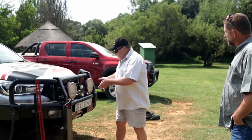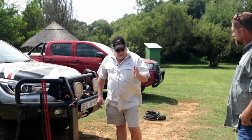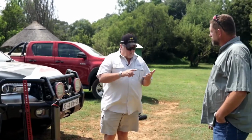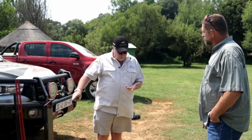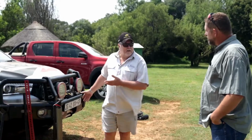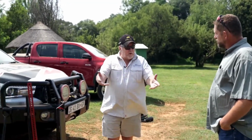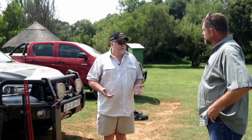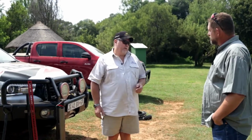So you have to have a vehicle that's equipped in order to use a high lift jack. If I don't have that, I can go and buy myself an air jack. Think about SUVs. Let's talk about a Prado 120. Let's talk about an Isuzu MU-X. Let's talk about a Fortuner. Think about all those cars, a Ford Everest. They don't have high lift jacking points. So what is going to be your cheapest way to go if you have to use a jack? It will probably be an air jack. But at the same time, learn to use the air jack properly.